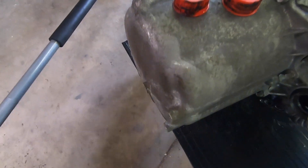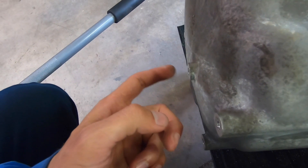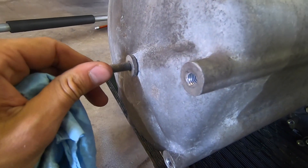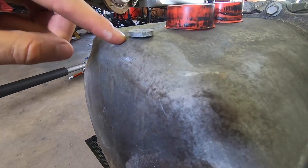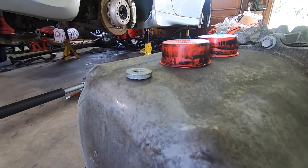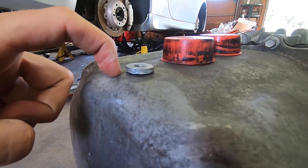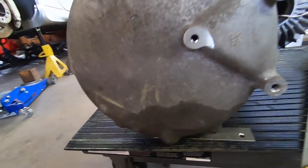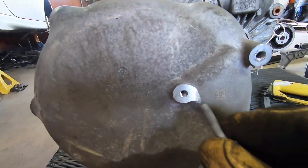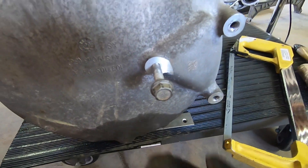The clearance is so tight between the frame rails that I'm thinking about cutting this off — retaining the threads of course because I want to use this for a mount. I cut all the way around it and it seems it's free now. That's how much thickness I cut off, and it tells you how much I need the space. This is how close this motor is to fitting between the frame rails, so I'll take the extra six millimeters. I just took the grinding wheel to it, smoothed it out, it's pretty flat, and my bolt still threads in. We are good.